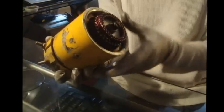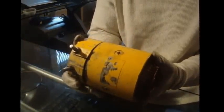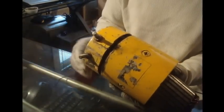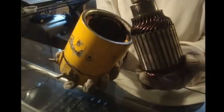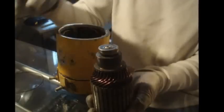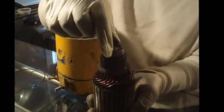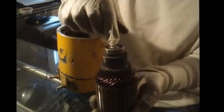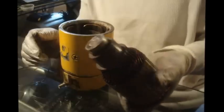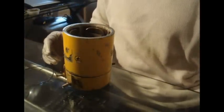On the front side where this connects up there is actually a back plate, but it's still on my truck — I don't need to take that off right now. You just put this ring back on there before you put it back on. This is the center part that has the armature head on it. You can see the bearing is on there and this little ring sits on the back of the bearing to prevent any friction as it spins. This looks pretty good — we're going to clean this up before we use it again.